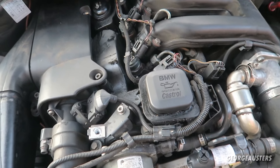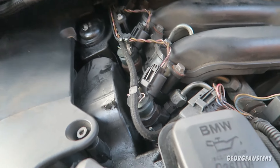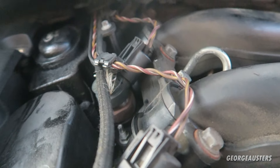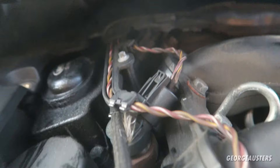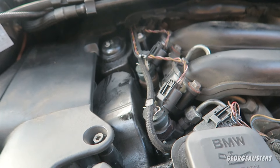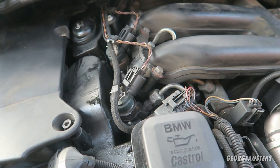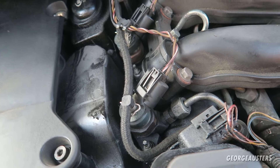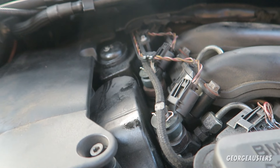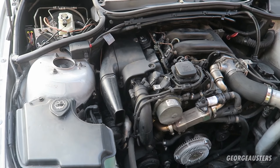The next problem on these engines is to do with the injectors. If you start to notice carbon and soot around the injectors themselves, there's a good chance they're letting fuel up the injector wells — the injector seals have failed. This is commonly known as black death. If you notice a chuffing sound from the engine and soot or diesel on top of your rocker cover, it's worth changing out your diesel injector seals.